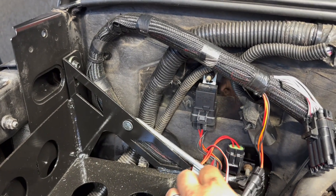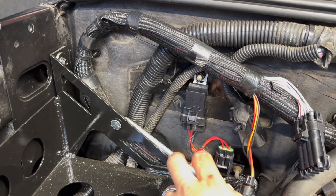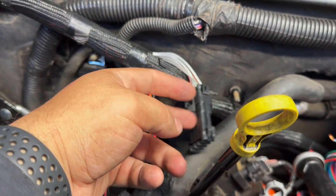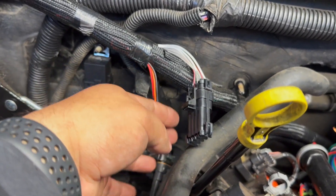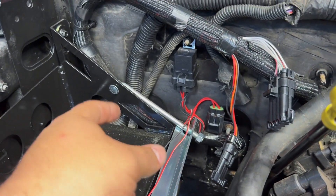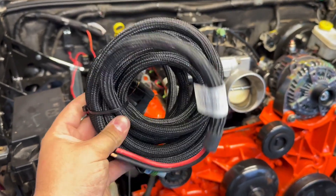Just to make things look a little bit better, I'll take some wire loom and loom those guys up. We do have a couple additional pinouts that are going to be available here — we'll discuss those as we figure out that we need them. Beyond that, we have a power and ground that we're going to run straight to the battery. And there's also another complete battery harness that we're going to need to install as well, and now looks like a great time to do that.